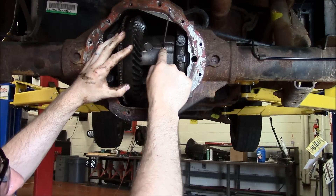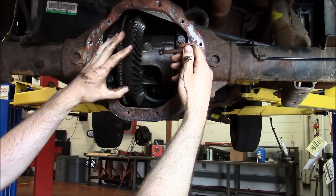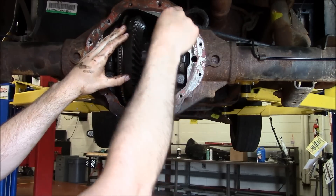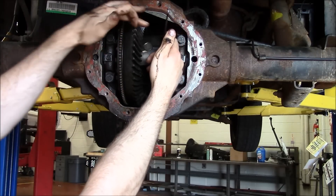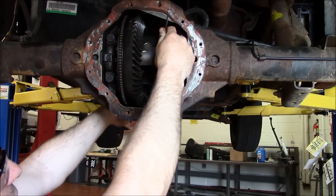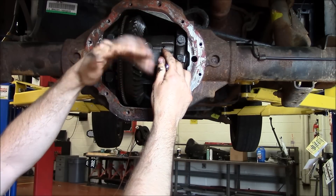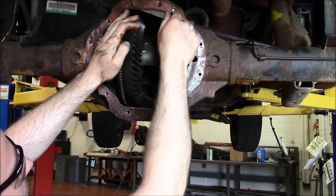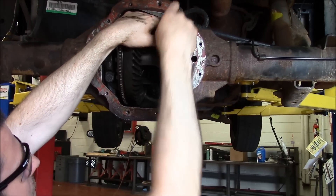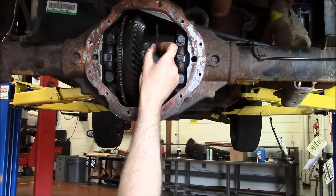What we're going to do is remove the bolt that holds the differential pin in. We've got a 5/16th wrench here — that's a pretty common size. I recommend 6-point if you can find it; we have 12-point now. To loosen it up, take the yoke, spin the yoke, and hammer the wrench against the case to break it loose. Ours has already broken loose. There's step four — remove the differential pin retaining bolt.